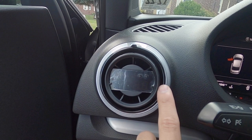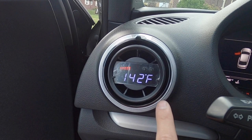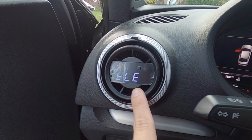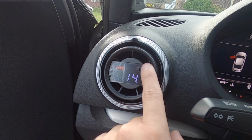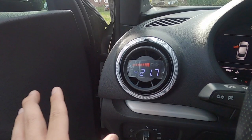Speed is obviously zero since I'm not moving. Battery voltage, intake air temperatures — 142 degrees, that's really cool. EGTs, ignition, throttle, and AFR — 14.7, right where it should be at idle. Everything looks like it's working appropriately. I'll probably leave it on boost for now. Looks like the install was a success — it looks really nice.